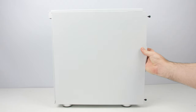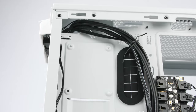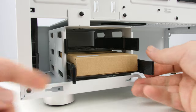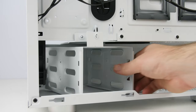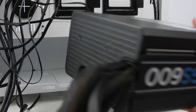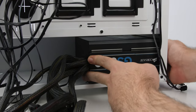Moving to the other side — removing the back panel — you get two 2.5 inch storage trays against the back of the motherboard, two extra 2.5 inch drive locations at the front of the case, and underneath the PSU shroud a removable hard drive caddy with two 3.5 inch toolless trays. For my build, I had to remove the hard drive caddy because otherwise there wasn't enough space for all the PSU cables, so keep that in mind.